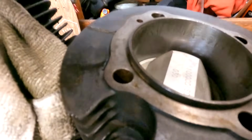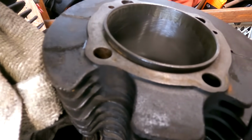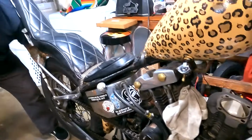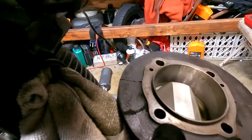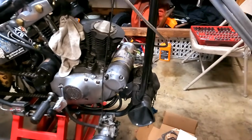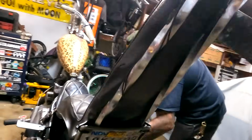Oh, I've never heard it breathe like that in a while. Airtight. Oh, it's the compression on this one. So that back cylinder has good compression. Yeah, I felt it too, and then like boom. Alright. Top end: smooth, no scratching, no hanging up, no binding. So all good signs, all good signs.